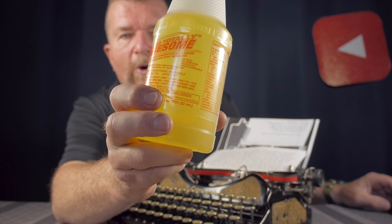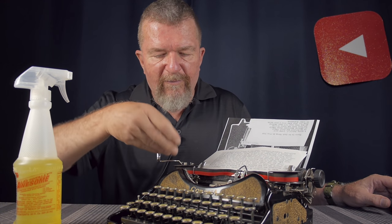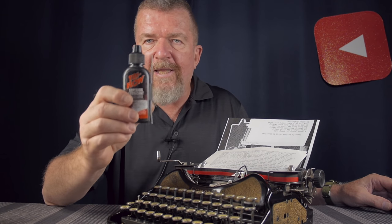I did a lot of degreasing to free things up. I took the advice of Diane Mayer, who visited us a month or two ago, and she recommended a degreaser called LA's Totally Awesome, which I got at a dollar store. I sprayed it on the moving metal parts underneath the ribbon drive, then worked the grime loose with a stiff hair colorist brush. I blew out the residue with an air compressor, followed up with isopropyl alcohol, then applied Tri-Flow firearms lubricant to any pivoting or moving parts. Those three products are pretty much all I used.